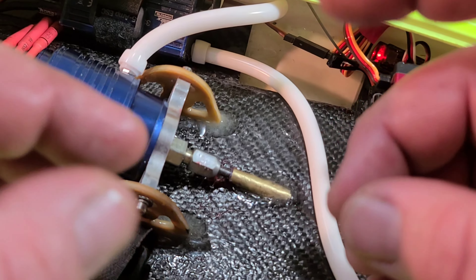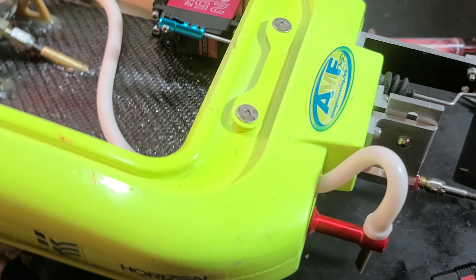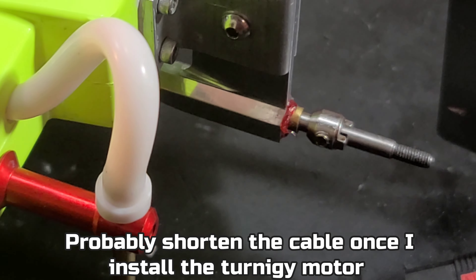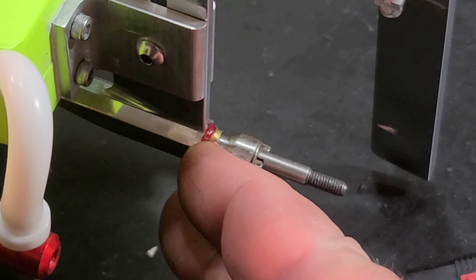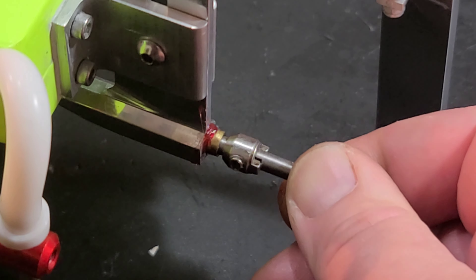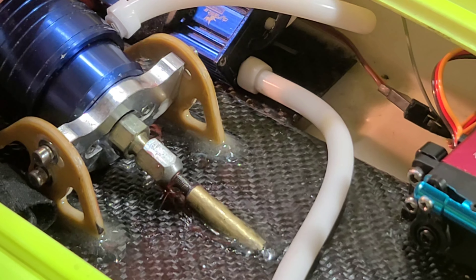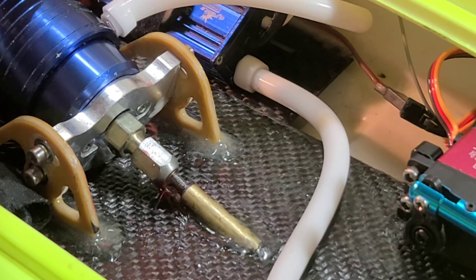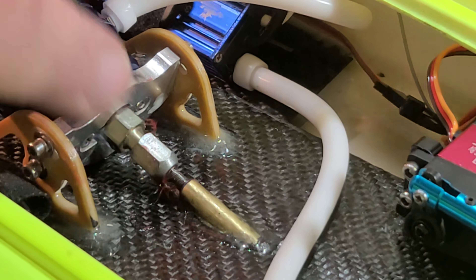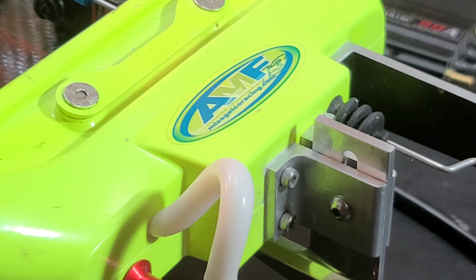Pull the foam off — only a little bit of grease came out, not much. Then spin your flex cable into the coupler. I don't worry about grease on the cable; I've had zero issues with couplers spinning due to grease. Tighten this down with an adjustable wrench — good and tight, but not gorilla tight. Don't get it too tight because it'll compress the cable and the cable will actually get smaller and smaller over time the tighter you go.